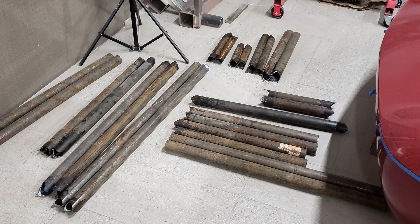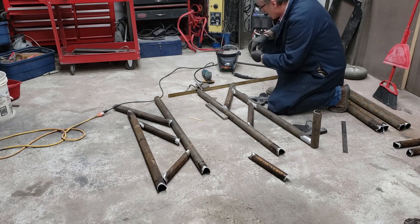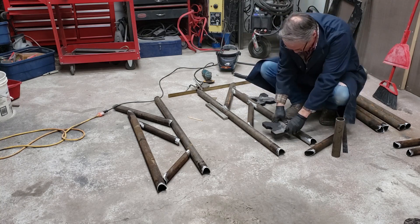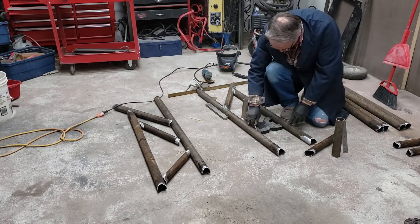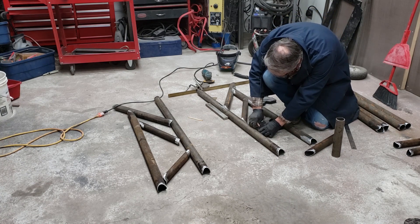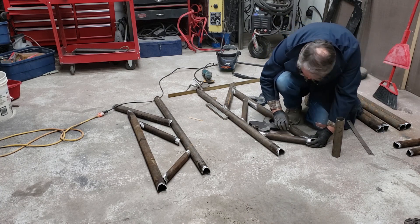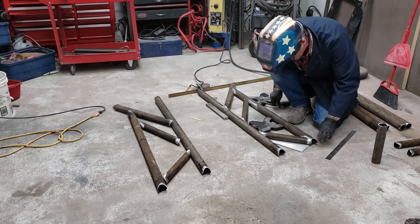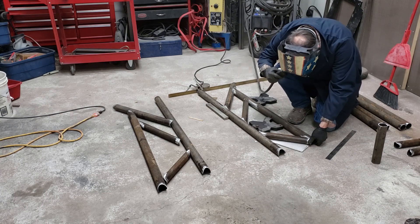This is a selection of all the tubing made for the front and rear subframes, getting ready to lay it out on the floor. There's no jig at this point because this is a prototype. Once the prototype has been in action for a while and we can see if there are any failures or stresses, we can adjust the subframe — that's when a jig would be created. For now it's just a matter of measuring, checking, measuring, checking, and making sure everything's in alignment and square. Once things are where they're supposed to be according to the drawings, it's time to tack weld them in place.